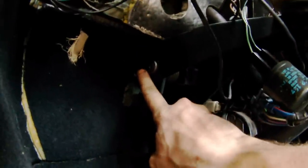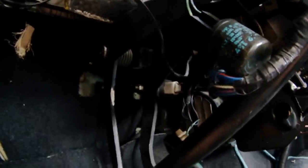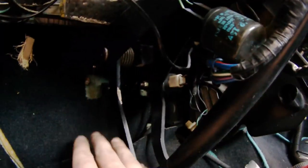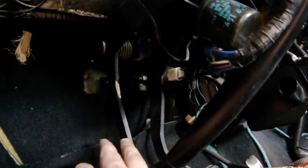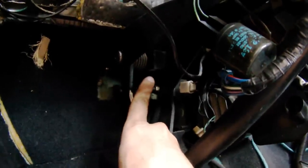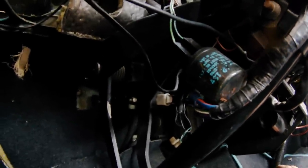One thing I want to mention: make sure that when you tighten this back down, you get that pin hole back in the hole on the actual pedal box so it locks that pin in place. Also, if you decide to do it this way instead of removing the entire pedal box, the bolt that's up here is going to be a pain to get back in — thread it very, very slowly. Hold the nut in place; I used my spanner and put a high-power magnet at the back of it just to hold the nut in the wrench, and then I was able to tighten it down.